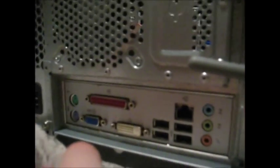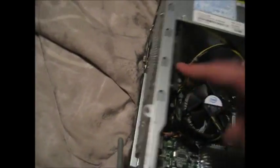And you've seen the back of the motherboard already. There's that fan I put in the front, and it just pulls air through the bottom of the case here and through these side vents. And this is an intake fan, and of course there's an exhaust fan here, and the power supply acts as an exhaust fan, so we should not have any ventilation issues.